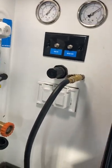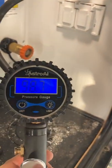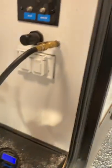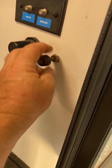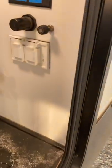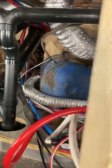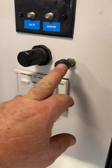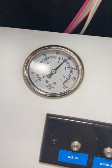Next to my Nautilus system I've got an air inlet, which I've got set to pretty close to 100 pounds right now — so you air it up there, screw on a TireLink sensor, which will connect it to the phone app. That TireLink sensor will give you the tank pressure. I've got a five-gallon — just an old junk five-gallon air tank from the scrap pile in the barn — so this feeds the tank.